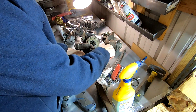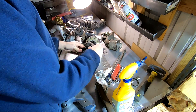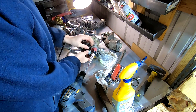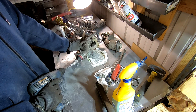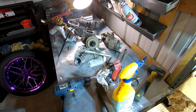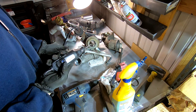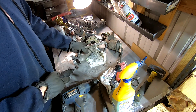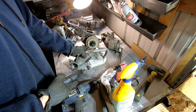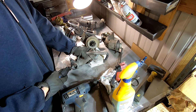I switched over to a 60-grit sandpaper I found in my toolbox; hopefully I can get it to stay on without falling apart. I didn't want to do it this way, but this is how you port and polish an intake manifold, so why not use it here. I'm going to use the Dremel to make it big enough and then use the hone to make it uniform — that's my idea now, because this is just not working out the way I thought.